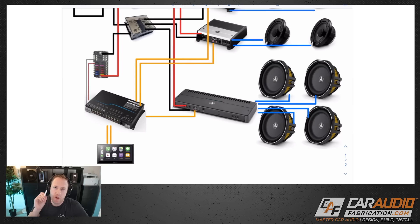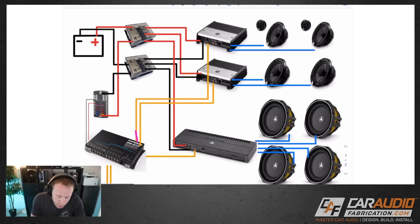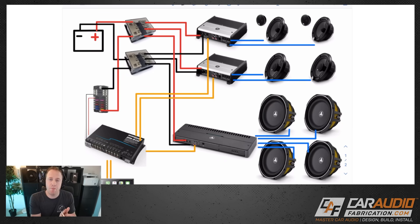The final wiring to draw in is all of our signal wires. I'm using RCA connections from the head unit to the DSP, and then from the DSP to the amps. I have an aftermarket head unit and I'm using a single line for each left-right pair of signal. I have two lines going from the radio to the DSP to retain front-to-rear fading capability — front left/right and rear left/right. Then out of the DSP: left/right to the first amp for front speakers, left/right to the second amp for rear speakers, and a mono signal going into the subwoofer amp.